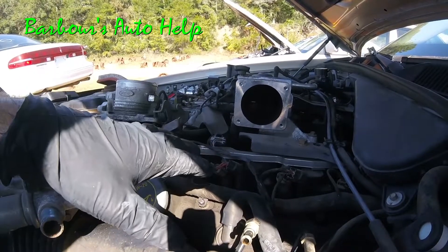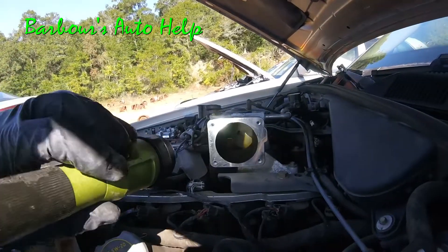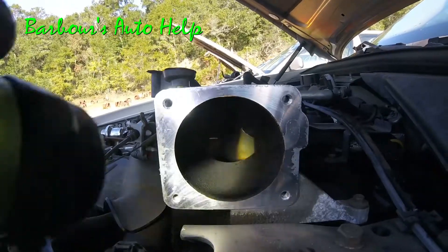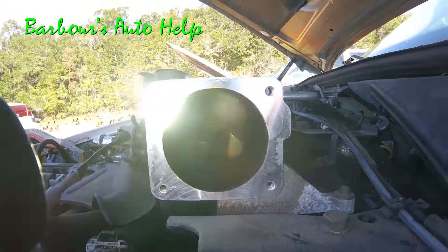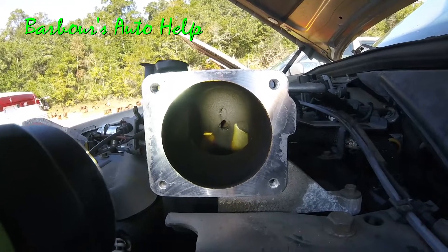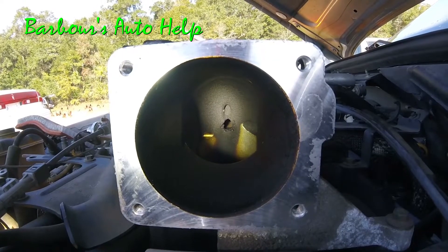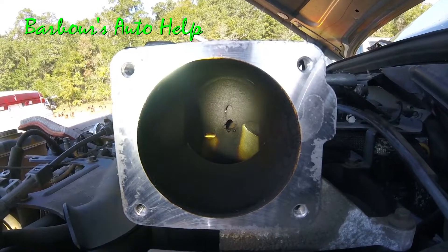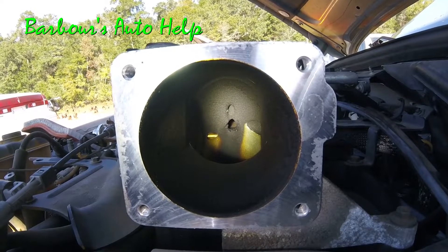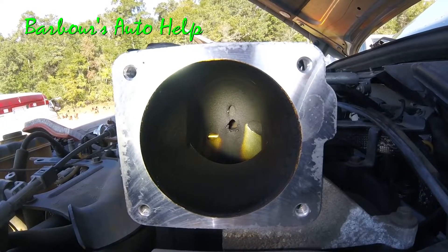What I've got in front of me here is a Ford 4.6 liter V8. Inside that intake you've got your EGR valve right there, and the throttle body is actually supposed to go right here — but you can look right back there and you'll see that EGR port. It's not clogged up but it's got carbon buildup and it's starting to clog up, and they do clog up. It's very common, right behind the delta pressure feedback sensor. This is the number two cause of a P0401 on a Ford vehicle in my opinion. So today I'm going to show you how to go ahead and take care of that.